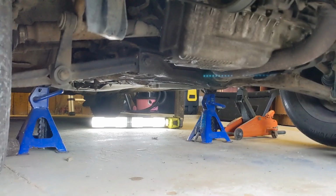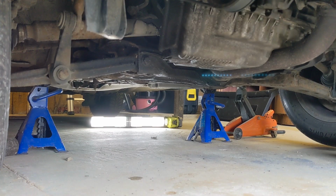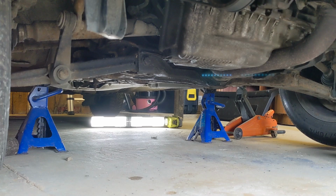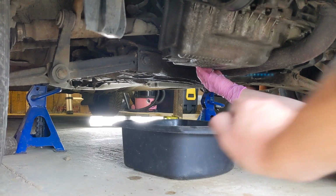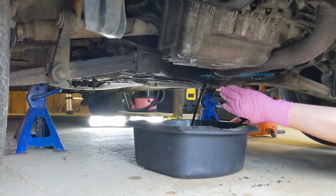Okay, so I've been under there and just quickly popped off the sump bolt. It's a 19mm. I usually go in with a breaker bar because you don't know how long these have been in, but it come off pretty easy with a socket, so Alessia is going to be taking it over from here. No pressure, pop it, you're on film. Just be careful when that comes out because that's going to squirt. Yeah, there you go. That's it, keep your hand over that.